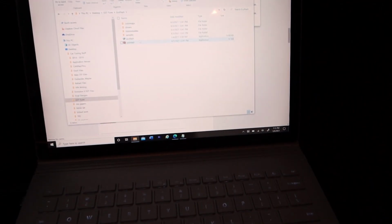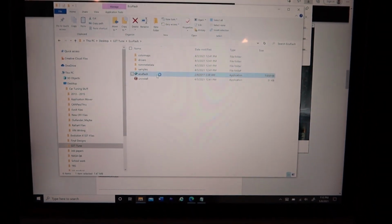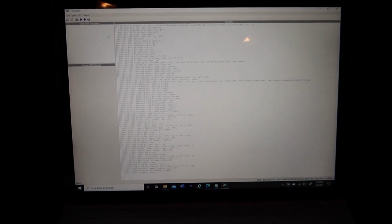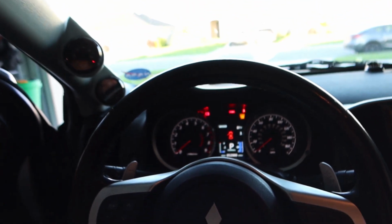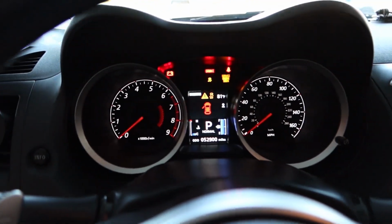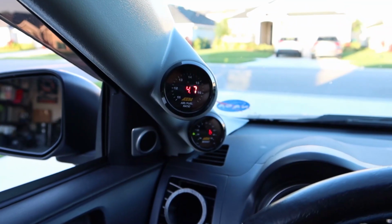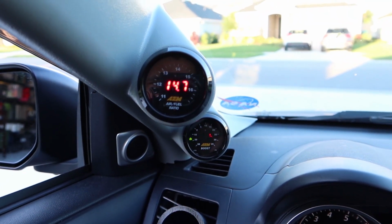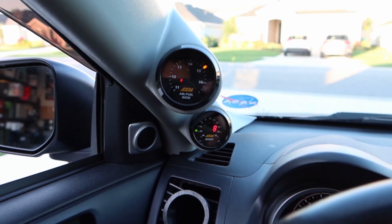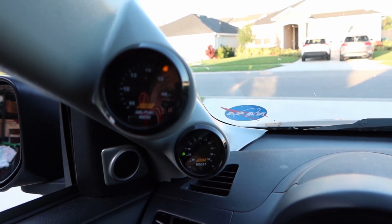Okay, with the car on, plugged into the laptop, we're going to go over to Ecu Flash. Right there, open her up. If you guys don't know what you're doing, I have another video I'll link down in the description below where I go in full detail of everything. But we're going to go ahead and flash this onto the car, and I'll catch back up with you guys when I'm done. Alright, and just like that, we are done. Let's go ahead and turn the car off. Alright, after the GST tune, there is our air-fuel ratio, 14.7. Looks pretty dang good. Pretty sure that's what the numbers we were expecting to see.